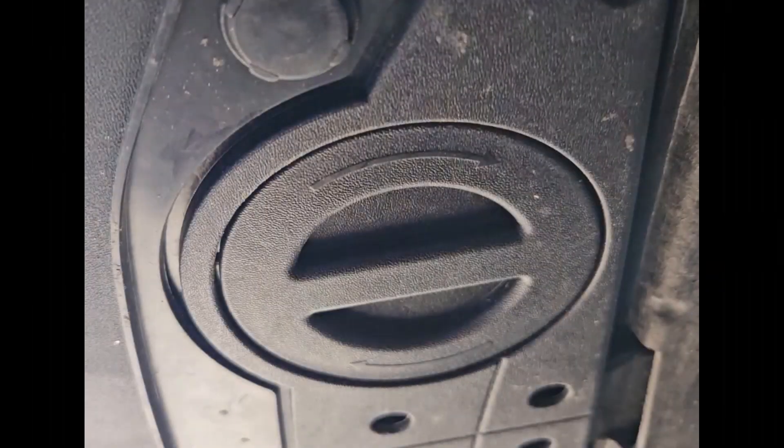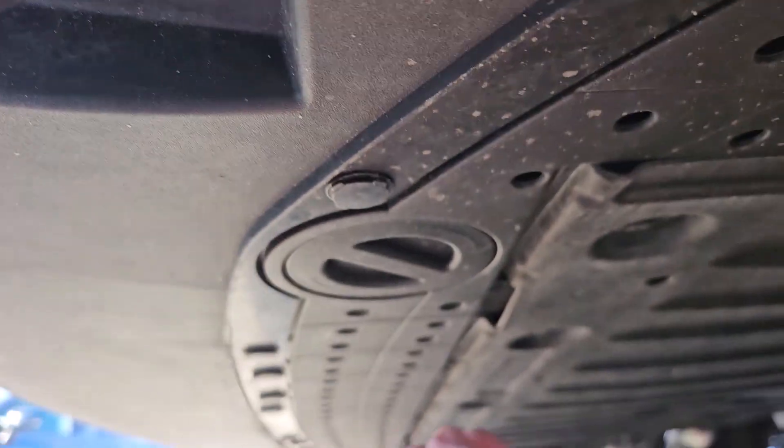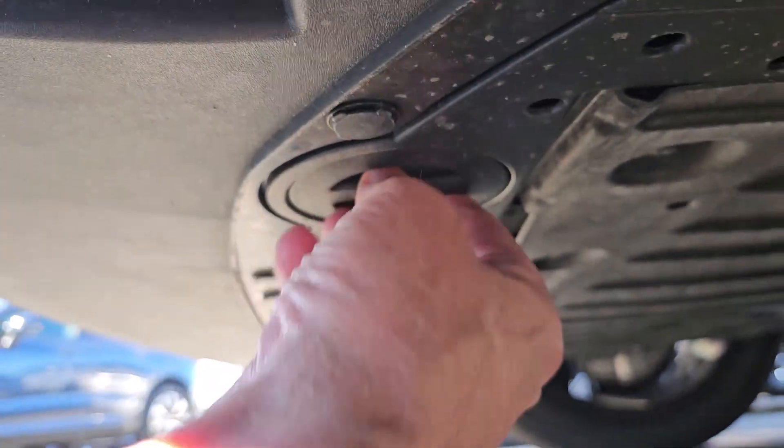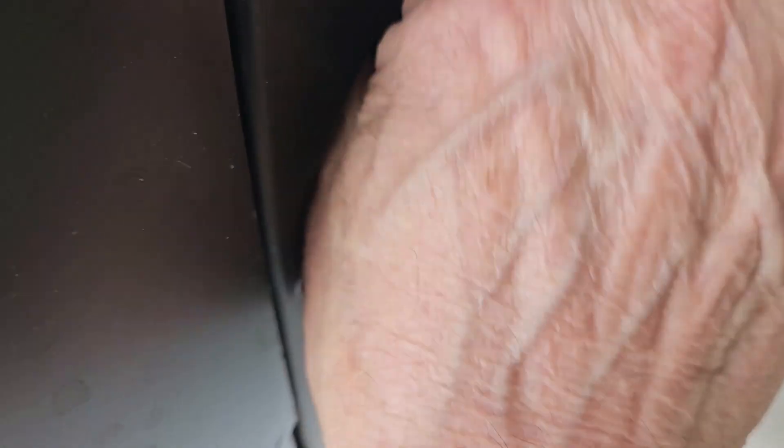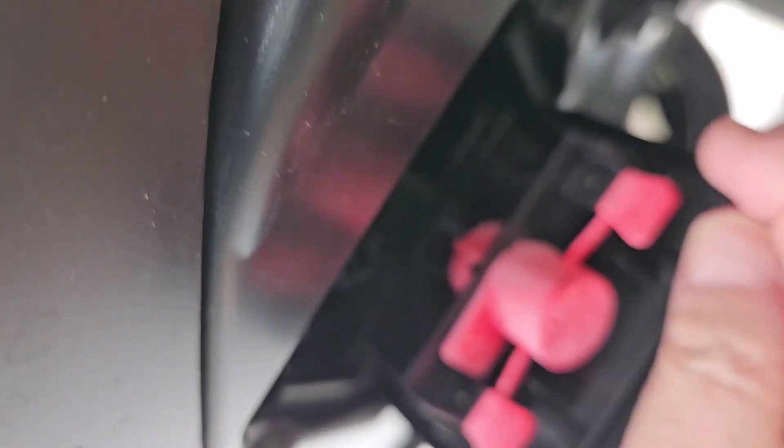Once you've found the terminal cover in Volvo models, a counterclockwise twist releases it, allowing the cover to be lowered. Two wires or terminals are attached to it. In the Polestar 3 and 4, the 12 volt terminal is again under the same side of the front bumper. It is a rectangular cover with a tab on either side to release. The cover then swivels down, and the two terminals are seen under plastic covers.